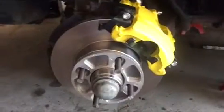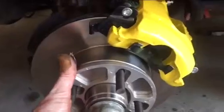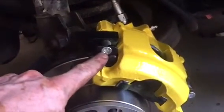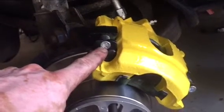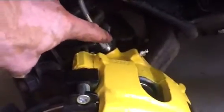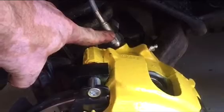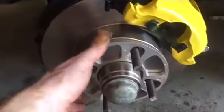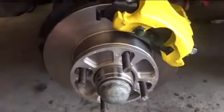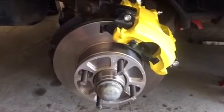I've got the rotors back on the vehicle along with the spacer, ready to put the new tires and rims on. New calipers are painted and ready. A tip if you're doing a brake job on an '86: it's a Torx bit number 50 to remove the calipers. Also, before you remove the old caliper, loosen off the flex hose first — it'll make it easier when you move it over to the new one. Bearings are repacked and everything is ready.